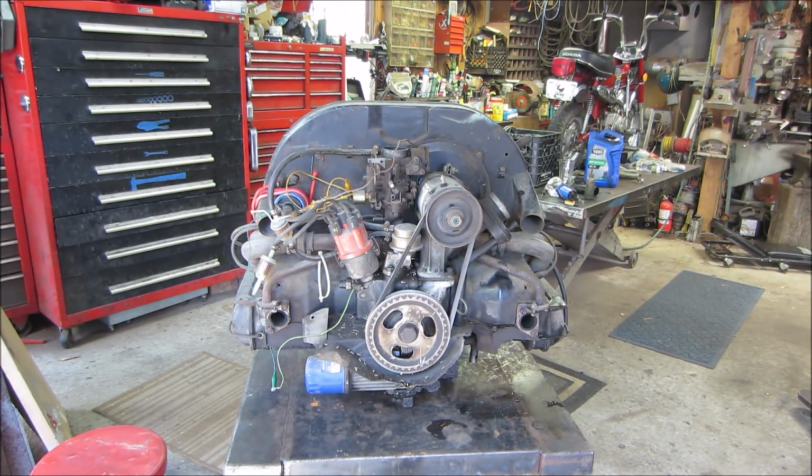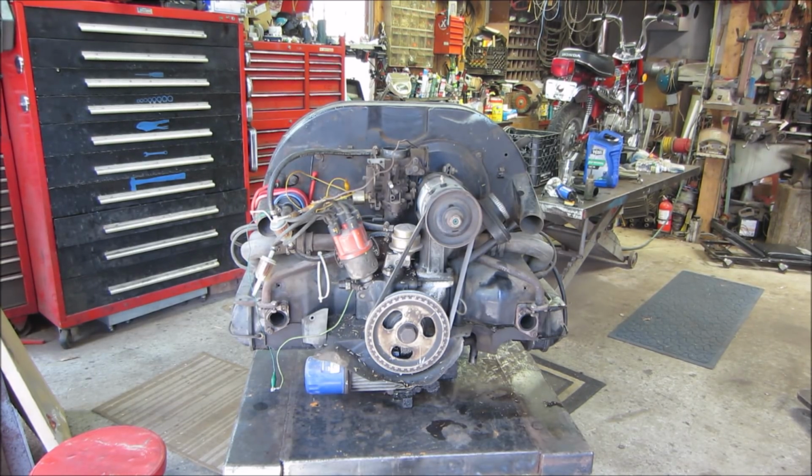Yeah, that's how I wanted to leave it. I wanted to put it away dry so it doesn't have fuel sitting inside there. That carb still needs to be rebuilt, but the fuel pumps have a tendency, especially with the new fuel and the ethanol that's in them, to take out the diaphragms inside those. So it's nice that all that stuff is left dry, because that apparently seems to work just fine.